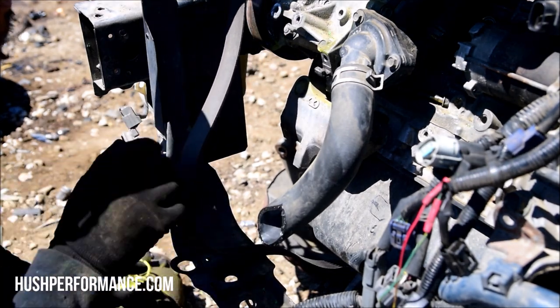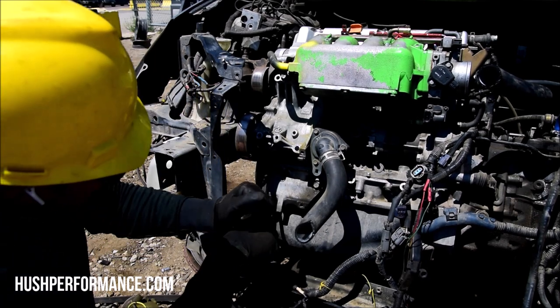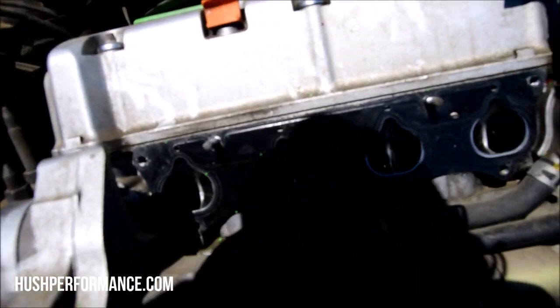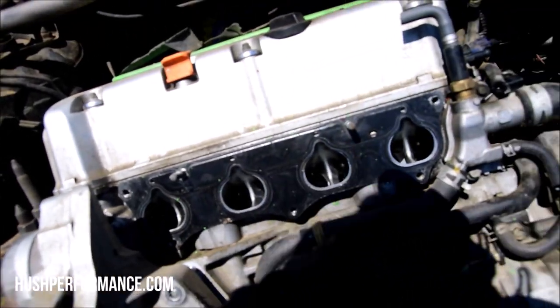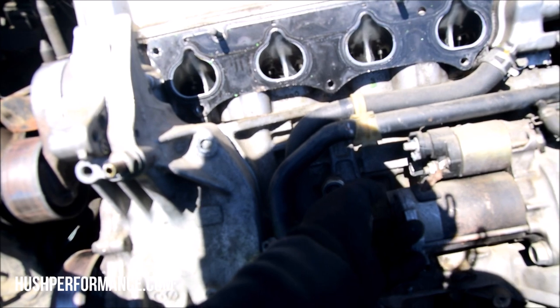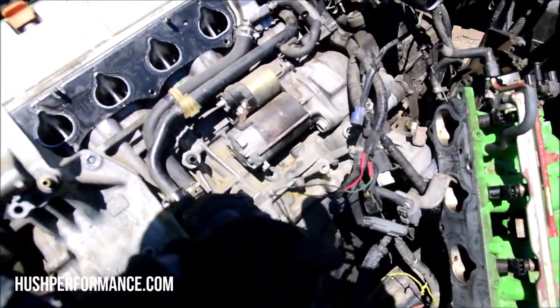With the intake manifold off and looking inside - man, that looks really nice in there. It's too bad this is a K20A3 because nobody wants these motors, but it looks like brand new in there - super clean, normally there would be a lot of stuff gunked up. Another good thing to grab is these knock sensors. Since it's right here exposed, I'll grab them. On other engines like early model K20A2s, they're a different style knock sensor and this plug always breaks off. I'll grab this and the associated plug that goes with it, because it is different than the one that normally goes on an RSX style.